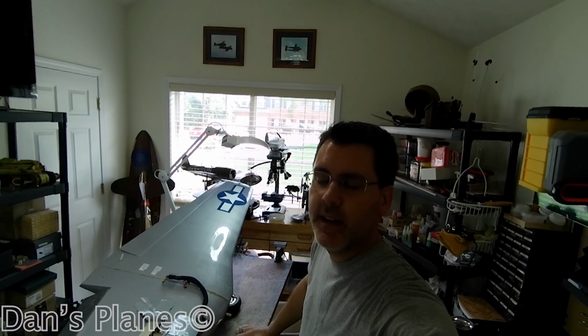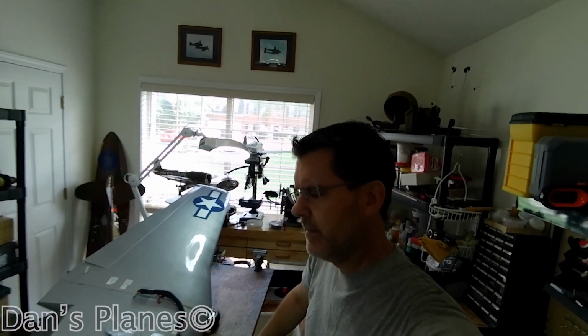I didn't have something tuned right on my engine. Must have. And that's the thing. The previous flight that I had on it, which is where I broke that leading edge I had just fixed, it was my first flight with my fuel instead of fuel that came with the airplane and the trailer that the seller had given me. So when I ran it for that flight, I had some engine problems getting it started, keeping it running, and I gave it a little bit more of a rich mixture and tried it again,